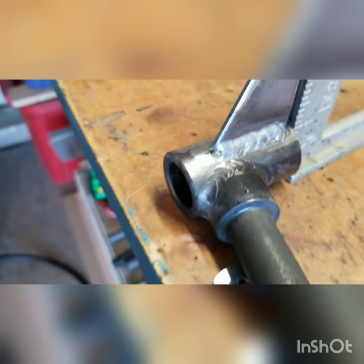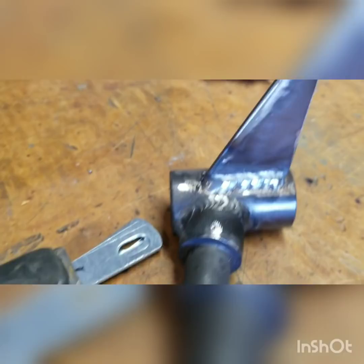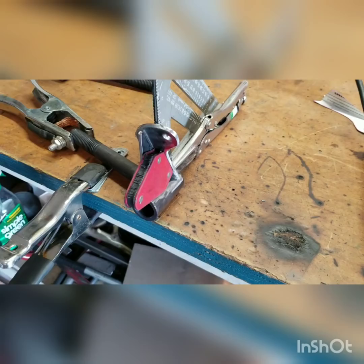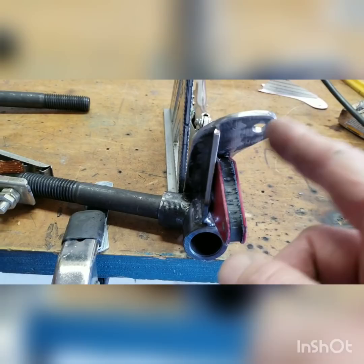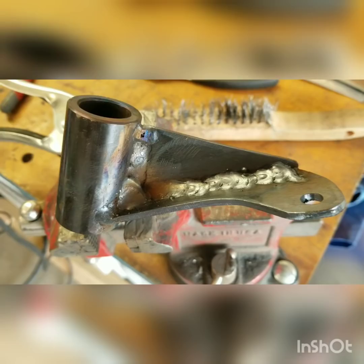So there's spindle number two — that's the back side or the bottom of it. Just trying to show you how much weld I put in there. Not my best weld ever, but it's not too bad. Really hard to get all that little splatter out of there because that's a corner — may just have to live with that. I went over with a quick grind to knock off the little splatters because once I put the other piece on, it's hard to get the grinding wheel where it needs to go. So we got the mounting plate set in place with a magnet and a clamp kind of holding it level, leveling it with the framing square. Measurement from the center here to there is one-inch offset — that's what we want. This is the critical point: keeping this one inch outside of the center.